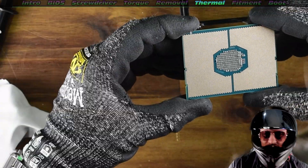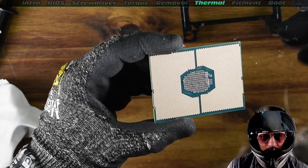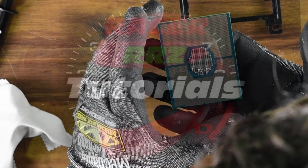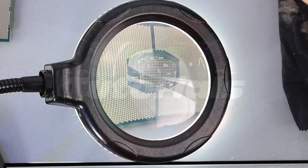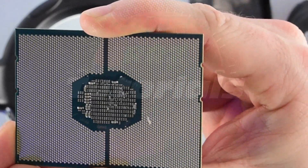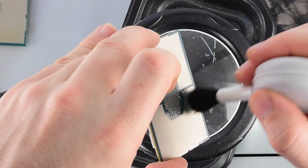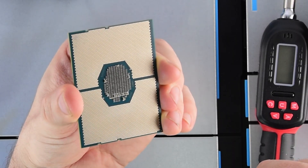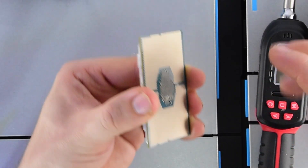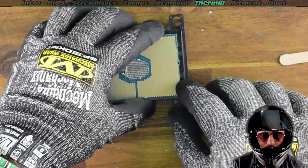Installation is really simple. I'm a little bit curious to check out what these old CPUs were. Another key detail: always check for thermal paste underneath the CPU. If you are selling these, always clear off the thermal paste for the person — you just create a mess. This one wasn't too bad.